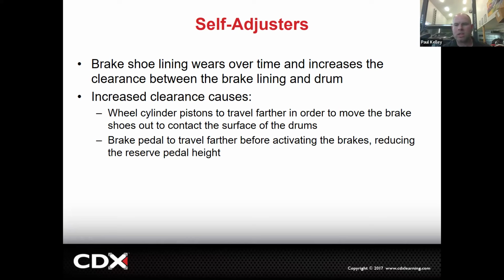And I've had several occasions where people actually come back and say, wow, I've had brakes replaced so many times, but my brakes have never felt as good as when you did it. And people want to think, is it because I'm really talented with the lathe? No, it wasn't that at all. It's just your typical flat rate line tech is going to slam out the front brakes and ignore the drums. And I would take a little more care and sell a half an hour or an hour to clean, lube, and adjust the rear shoes to the drum, and it would stop so nice because the pedal was higher.